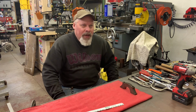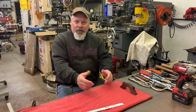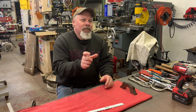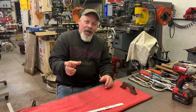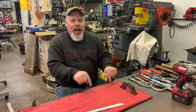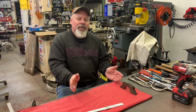One more note on that, the rear main seal. Over the years, there's been techniques. This is a 2-piece seal block, both of them. People have staggered the seals. I've done it myself. I've suspended that operation, just 2 dabs of sealer. When you put the halves together, it's fine.